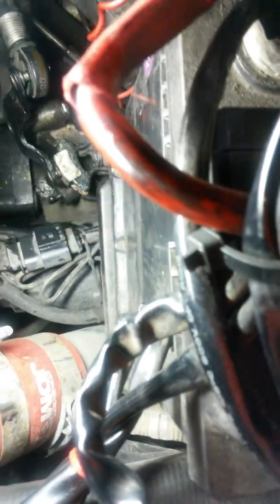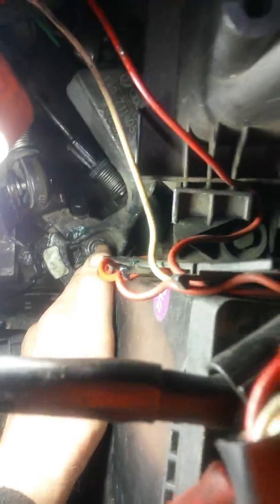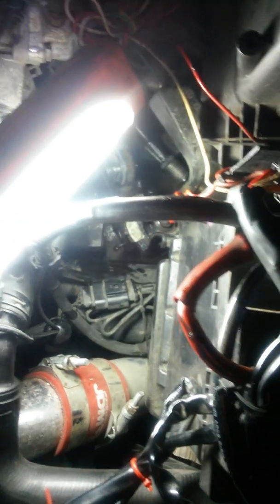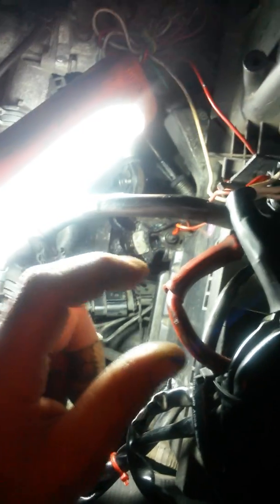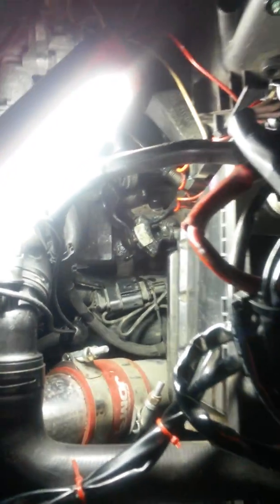There's a nylon bushing up underneath the shift tower, and you see this threaded part here. That's your shift tower underneath it, and that's a rod that goes right through into the transmission. There's just a crappy little nylon bushing. It's the hokiest piece of crap I've ever seen on something this important. Mine's worn out on one side, so it allowed for about 1/16 of an inch of play. That allowed the dirt that gets up underneath here to get down inside the whole assembly and gum up the grease that was in there. Of course, that gets in your transmission too. It's just a poor design. If it were me, I'd put a brass bushing in there. But I didn't design this thing.